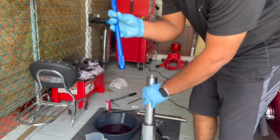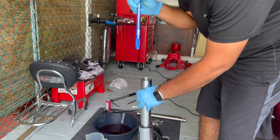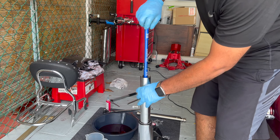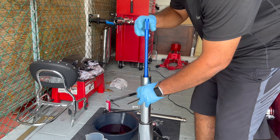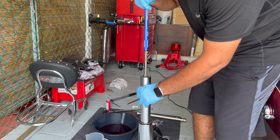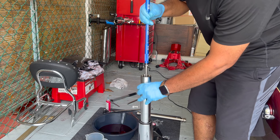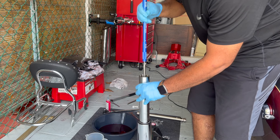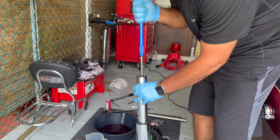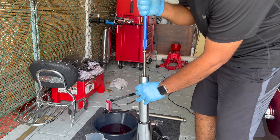To bleed it further, this is a damper rod holder tool from Motion Pro. All it does is screw onto the cartridge. You can pull up the cartridge easily and to bleed it, just pump it a few times — start with small strokes first and then larger strokes. Keep doing this until you feel it become a little smoother.